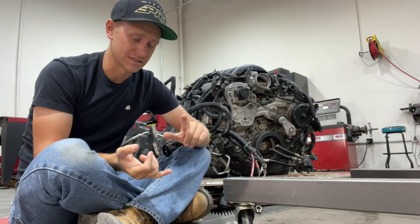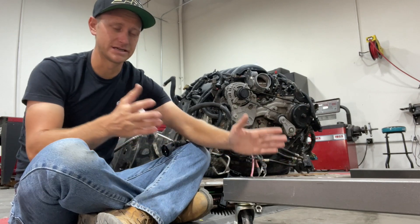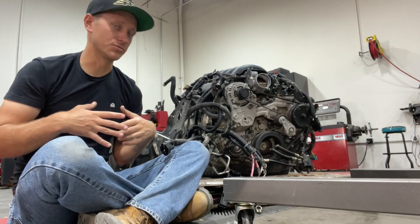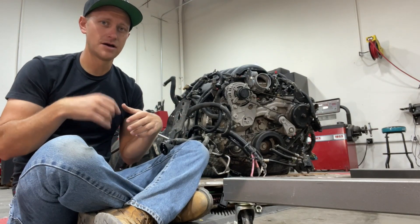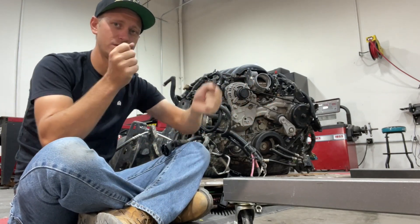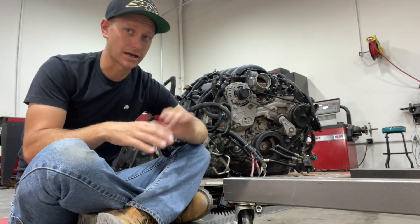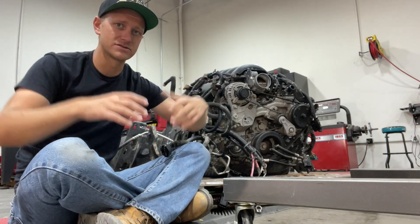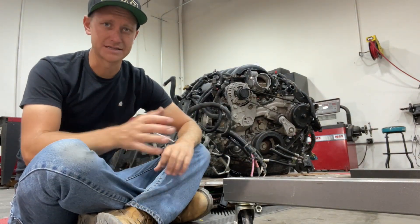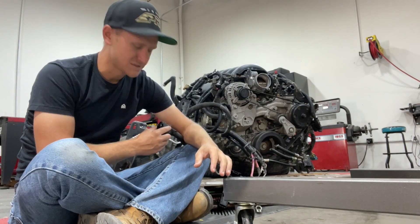The things I'm most concerned about are foot space for pedals and how far away the dash is going to be from the seats. Since the firewall is moving back, the seats are moving back, the pedals are moving back, and the driver and passenger will be set way far back in the car, but the dash is still flat on the front. So that's either going to be cut out and set back so we can reach the steering column and see the gauges, or we'll cut it out and build a new one that conforms to the driver's legs and brings everything closer. This is step one of that process so we can build the ergonomics of the car.